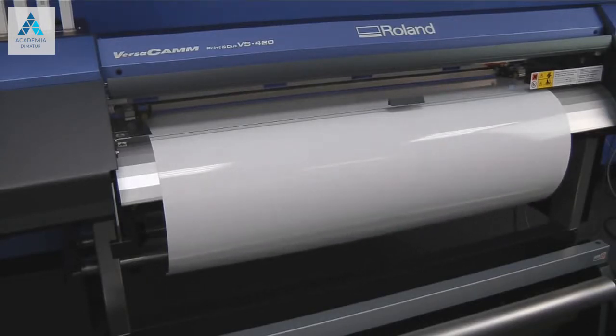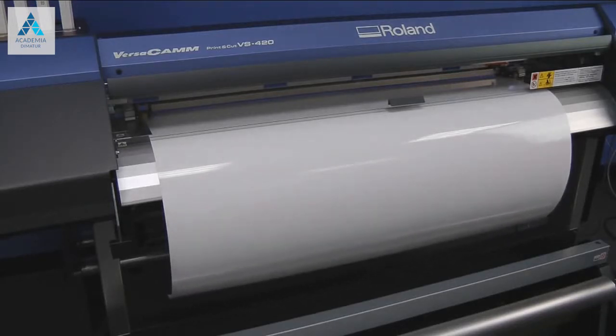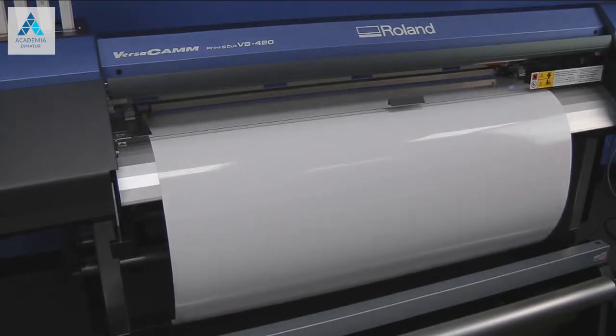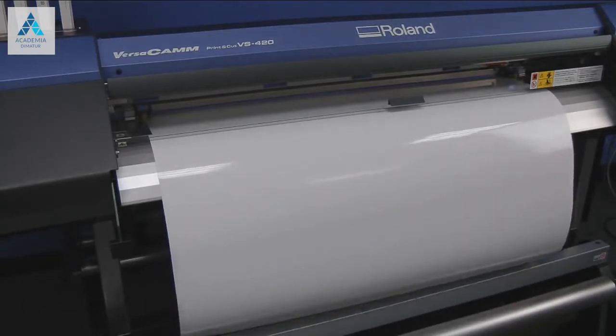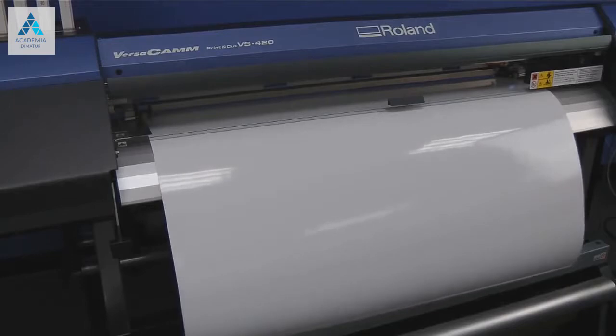The other is to print your job until you have enough media to actually attach to the core. While this does save media, an additional feed calibration may have to be performed because the tension on the media is different and it will feed differently.